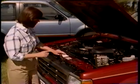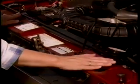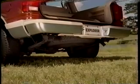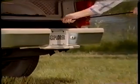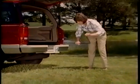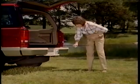While we're here, the jack handle is located just above the radiator. It snaps into rattle-free clips for storage. If you need to change a tire, the spare is located here, at the rear under the cargo compartment. To get at the spare, simply insert the jack handle into this slot and turn counterclockwise to lower it. Just reverse the procedure to stow the spare.